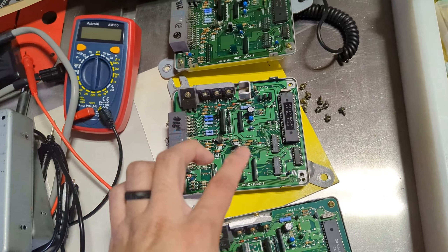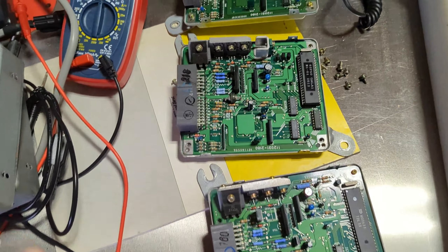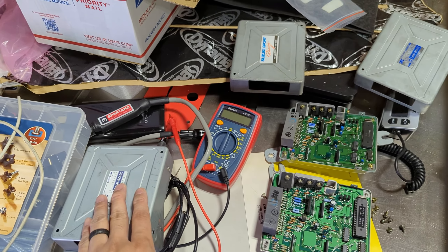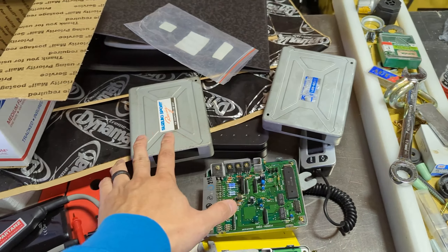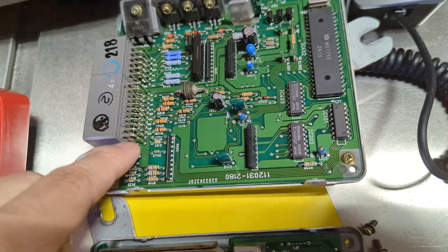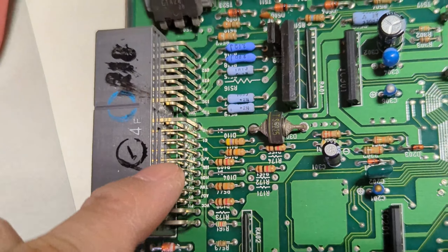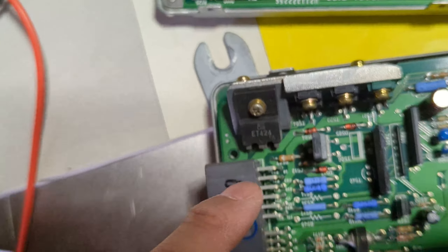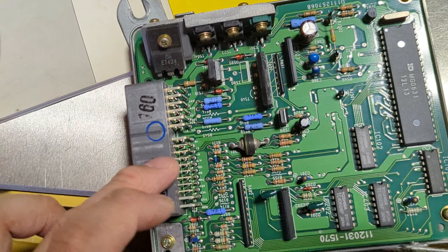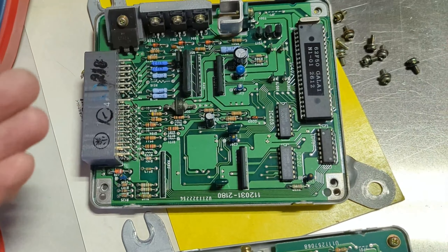Can't believe everything you hear. I took the covers off my car's ECU, the cappuccino ECU, and the mystery Suzuki sport one. Looking at the original car ECU pins — all these pins line up with the cappuccino swapping mod where you need to move some pins to make it work. ABV and a bunch of other signals get moved, so ABV was no longer in the same port on this mystery unit. That explains why the ABV does not work.